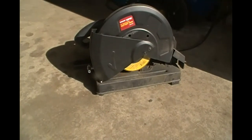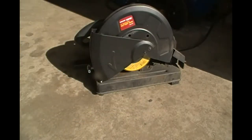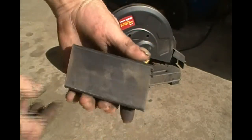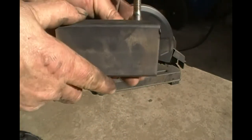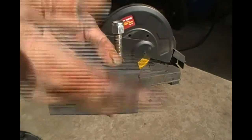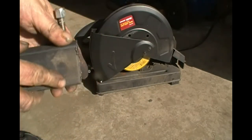I guess you can see that. Anyway, I cut off two pieces of that, the same width as that plate. And my plan is to take and drill holes all the way through it in accordance to that plate where the mounting bolts on the engine go. And run some big long bolts, like so, all the way up through the bottom, up through this, up through the motor, through that other plate — which will help keep it from wanting to wobble back and forth, I hope. And put some nuts and lock washers and things like that on there.